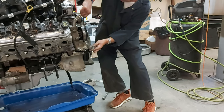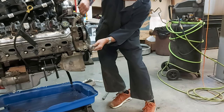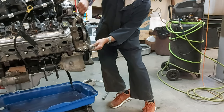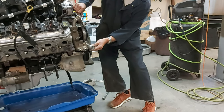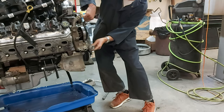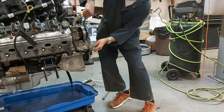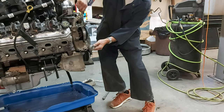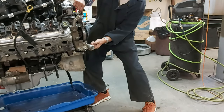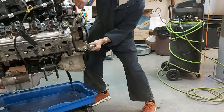We'll see how far we can go before it digs into the wall at the back there. Again, 1/8 NPT, and the 21/64 drill bit or 0.328 thou — I used a 0.332 because I had it, close enough. This is just to get rid of that steam line that goes through the throttle body; we'll just tap into here with a line and it makes everything nice and clean. You don't have to worry about the steam line going to the radiator. It's probably easier to do this if you take the whole thing off, but since we had the engine out I didn't feel like removing the water pump.